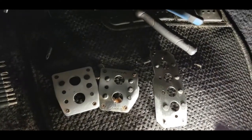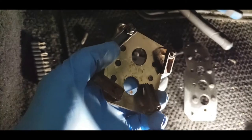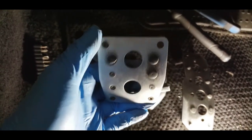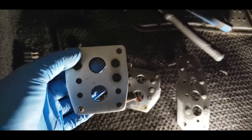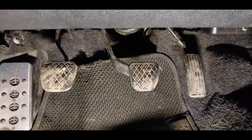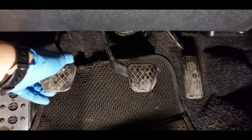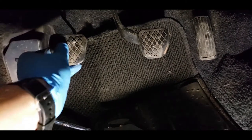So I did manage to remove the OBX pedals — they were a pain in the ass. The bolts on the back are held on with nuts but they were so old and rusted that as soon as I tried to use a screwdriver they just stripped right out. So what I did was get some pliers, went on the back, and twisted these little clamps out and slid the pedals off. If you look at the original pedals now — the brake pedal is a little bit worn out. If I wanted to remain OEM I'd have to replace the rubber piece, but these come on and off pretty easily. You just pry on the lip and it slides right off.